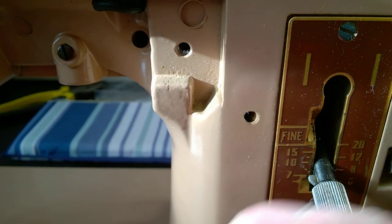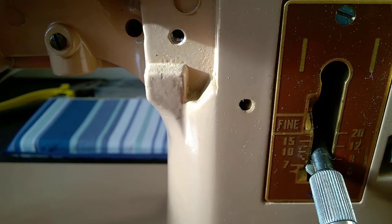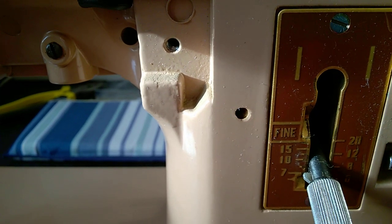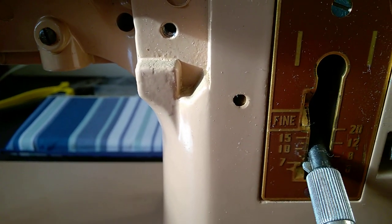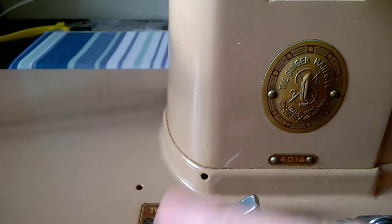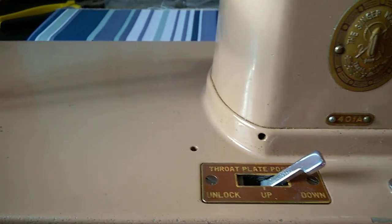Engine oil, any engine oil, if you can find synthetic, it's even better because it's going to last longer in there. It's going to lubricate much better worn metal sleeve surface, especially this point, but perhaps also this point as well, if you can. Now, this is another lubrication point.